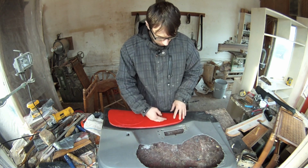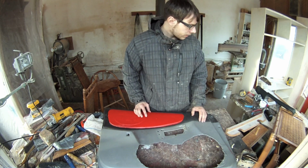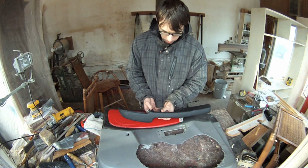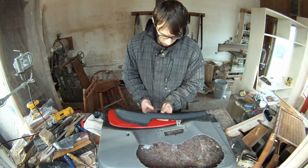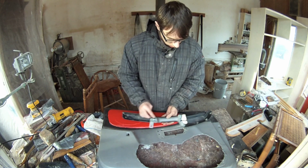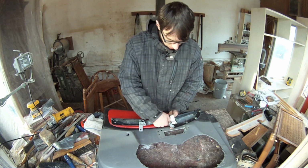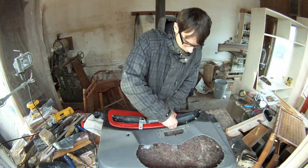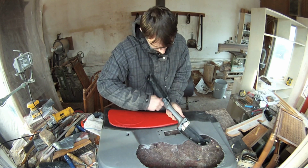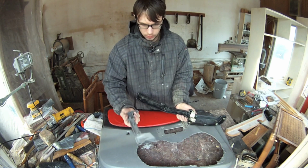This right here is for the latch, so that has to get cut out. So step one is going to be disassemble. I first took my handle off. This is from the opposite side door. It was just basically grinding off a couple of plastic rivets, which I'll show you on the back of this, and then this piece comes off, kind of, hopefully. So that piece comes off.